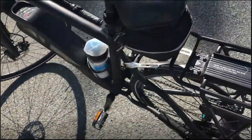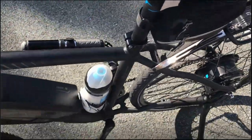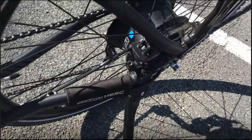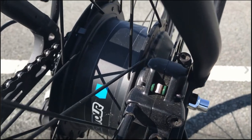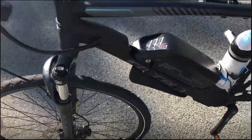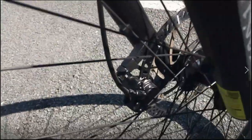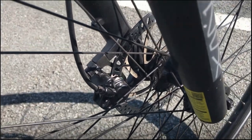I haven't looked into that yet, so I would not assume it's going to be normal car DOT 4 or something - I'll find out what the proper fluid is. You have to bleed them at some point if they get a bit soft; you can get air bubbles in them. You can see how neat it is - there's no cabling coming out the back or anything. I like the idea of hydraulic brakes on this because every gram of pressure you put on the handle is instantly transmitted to the brake caliper, because hydraulic fluid will not compress.